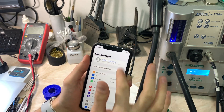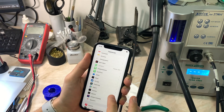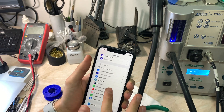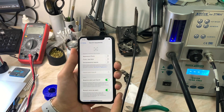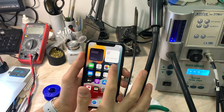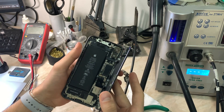So now I'm going to show you that all the cameras are not working — even the flashlight is not working, which is obvious. The first thing to do is check if we have faulty cameras. If everything is okay with our replacement parts, that means we have a problem with the board. So let's take working parts — other cameras — and check if we can repair this problem easily.